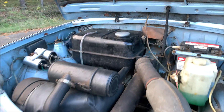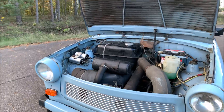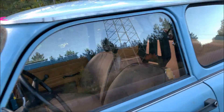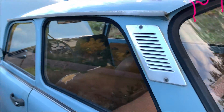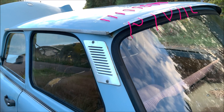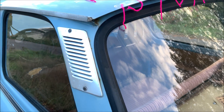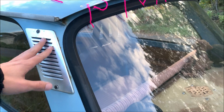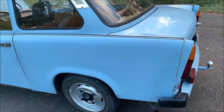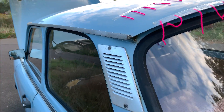The clever thing is that there is quite a lot of overpressure at the front of the Trabant because it's so straight, with a lot of pressure at the entrance. Looking around the car, this is actually the air outlet of the interior. We have pretty high wind velocities along here and along the C-pillar, meaning there's lower pressure here. It was quite standard in the 1960s and 70s for cars to have the interior outlet here; nowadays it's hidden underneath the side panel near the bumper.